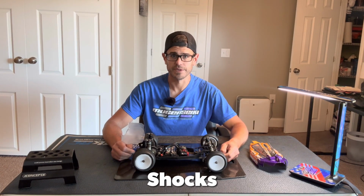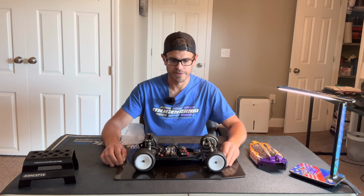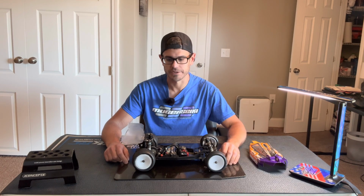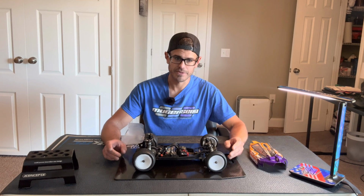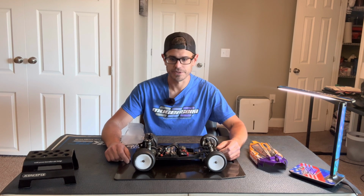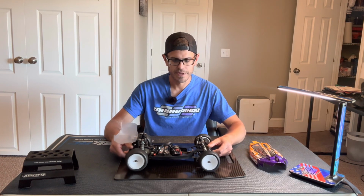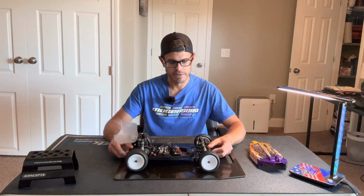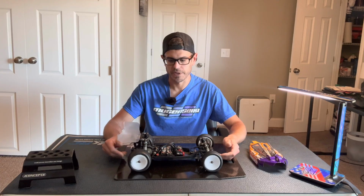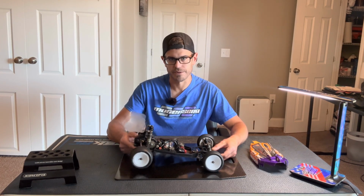All right, the next topic we're going to cover is shock packages. So it goes without saying, if you're going to run them outside on a natural dirt surface, you want a very soft shock package to generate mechanical traction. So it is a fine balance though. Too soft of a shock package can actually create unwanted weight transfer, which usually weight transfer is good for getting the buggy into the track. However, one of the things that I found in testing is, if you have too fast of rear to front weight transfer like this, it makes it really hard to enter a corner consistently because all the rear tires being essentially unloaded off the dirt.